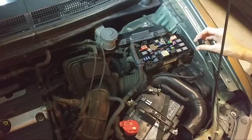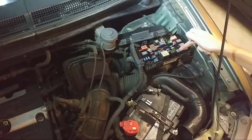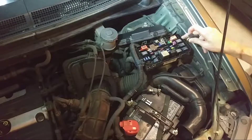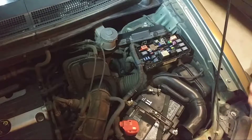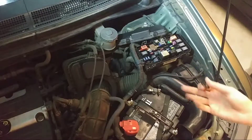So what I did is I just ordered a new set — these are all new. I ordered a new set of relay switches. These are the OEM equivalents for like 20 bucks; I got four of them. I just changed out all of them, and of course the compressor came right on and the AC was running fine again.